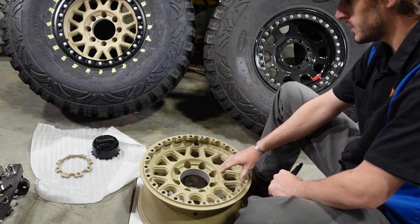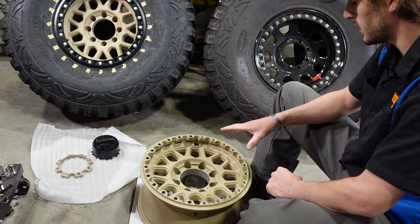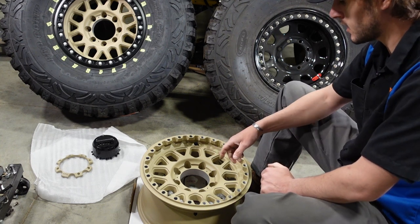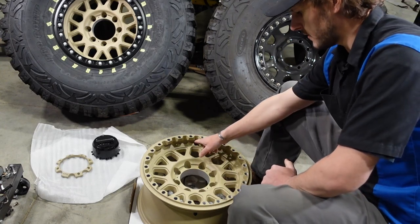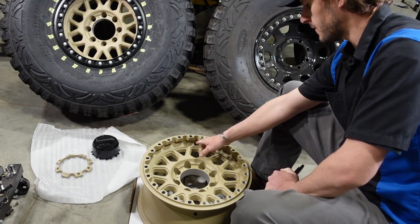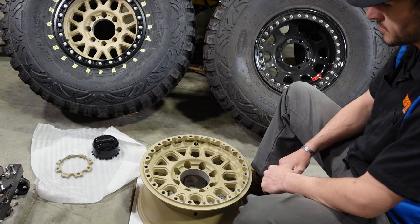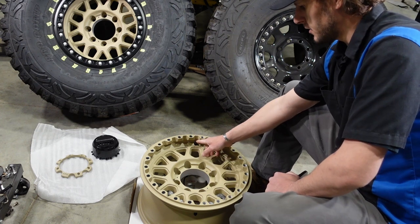On the wheel itself, they have two valve stem holes so you can air down quicker when you hit the trails — I really like that feature. These holes are 0.46 inch diameter. I'm trying two different valve stems and I'm being picky about the colors since I spent enough on powder coating. I got these off Amazon — they're black coated brass, so they're softer. They're the bolt-in style. Normally bolt-in style would be zinc plated steel or chrome steel, which is a lot stronger. We'll see how these last.